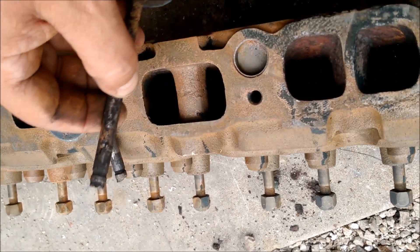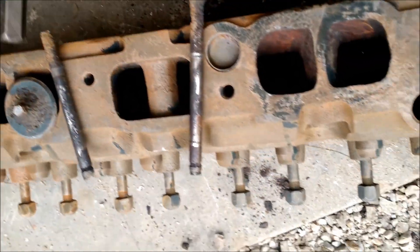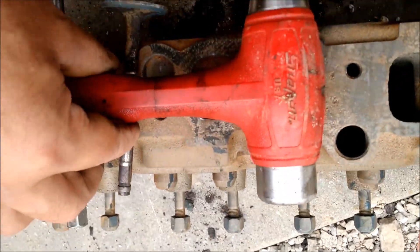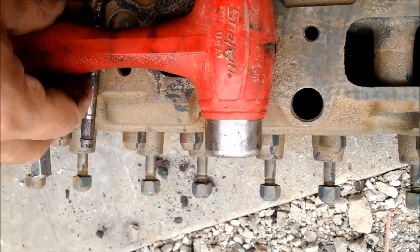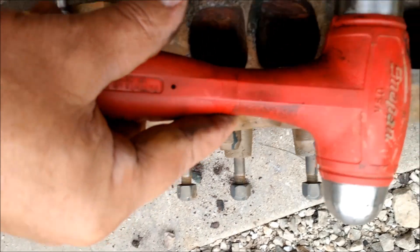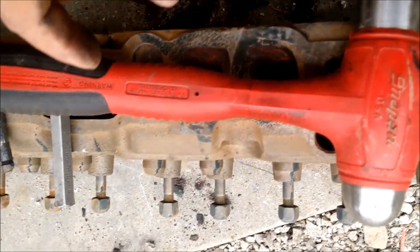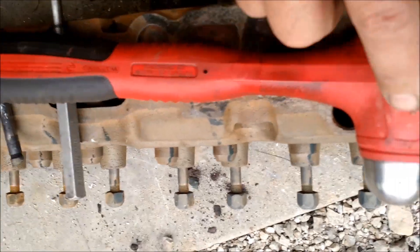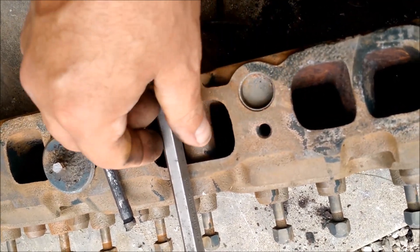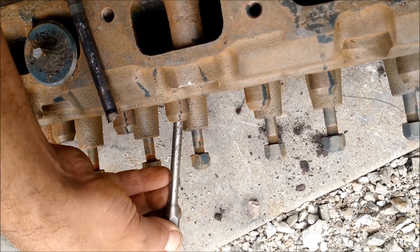These did pound out with a hammer. The way I usually do it is I take two hammers — and I know in shop class they say do not hit two hammers on each other — but I put one hammer on the valve stem and hit it with the other hammer. That way I don't bend the tip of the valve. If you hit directly on the valve tip, you'll bend it and it won't go through. Once it's into the valve guide, I use a large punch and push them all the way through to get them out.